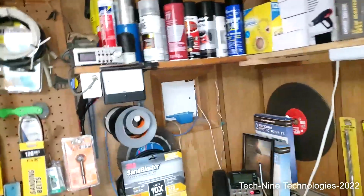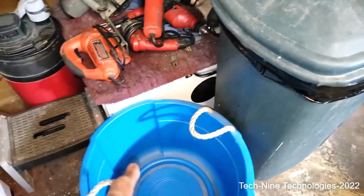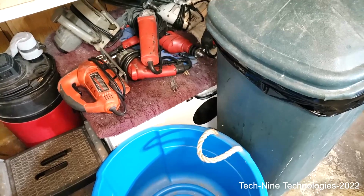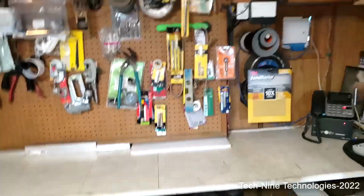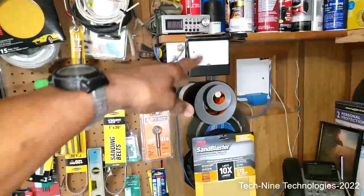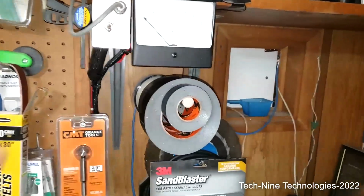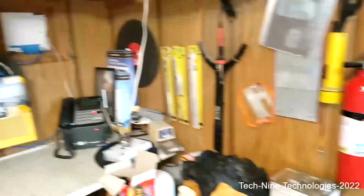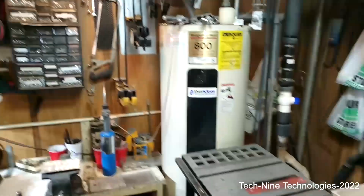Oh, you see that regulator up there and that meter under this thing down here? I got a 250 amp alternator under there, and I turn it on and it runs. And then I got one battery in there up under that seat that I sit on, and I can hook up regulators. I can test regulators in here for people to make sure they work. Matter of fact, let me just turn the light on and see where it's sitting. It's sitting at 12.5. Yep. So this is the room where I fix all this stuff up at.